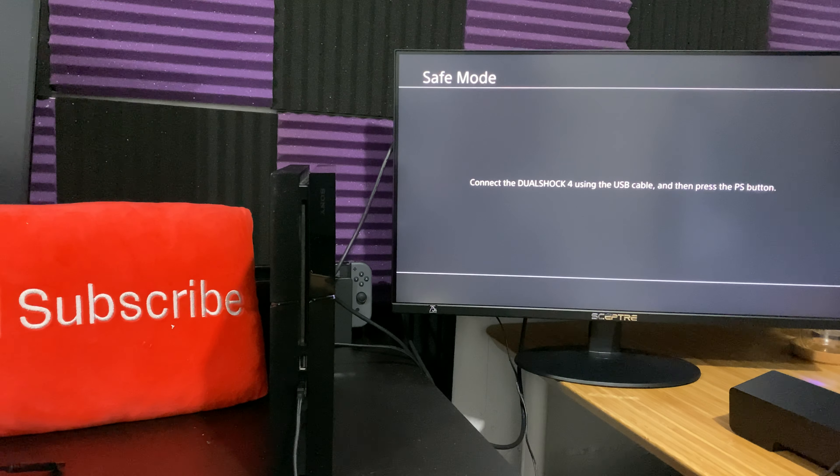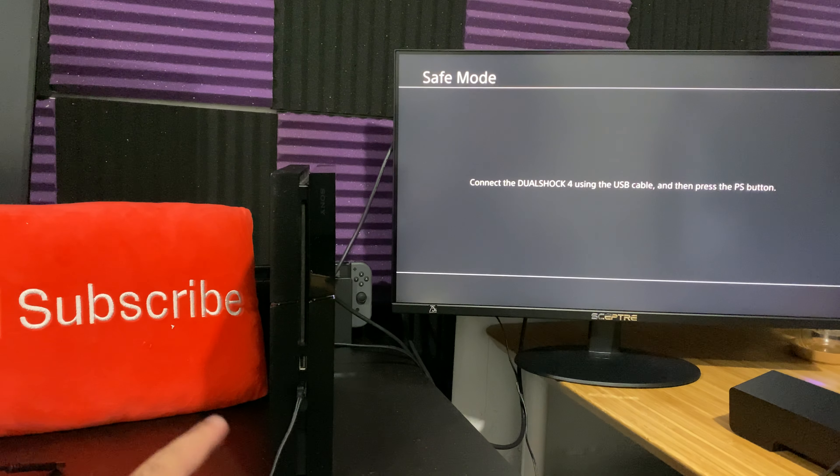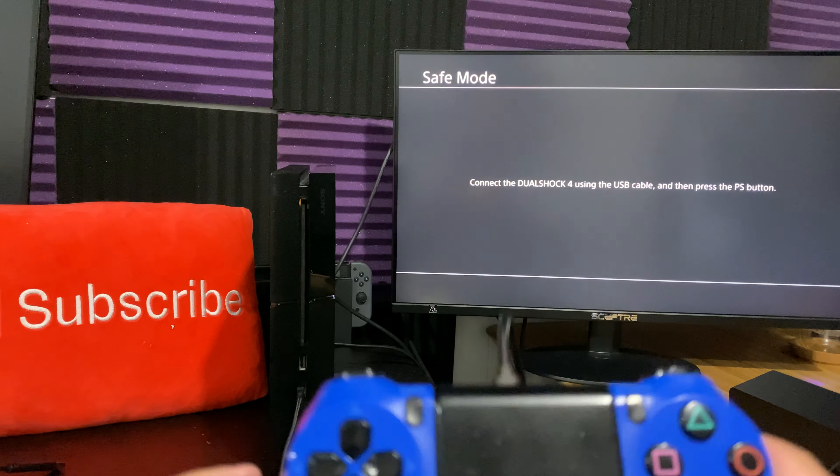An interesting thing — if you don't hear another beep, it's still good to let go after a maximum of 10 seconds, because there's a possibility your PlayStation is old and it doesn't make a beep, whatever the case may be. Now, you have to connect your controller with a wired USB cable to your PlayStation 4. If you do not do that, it will not work.